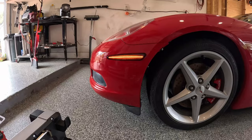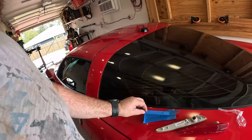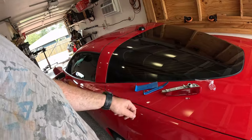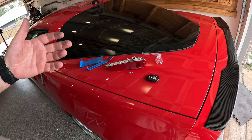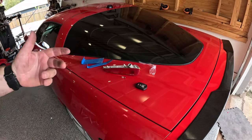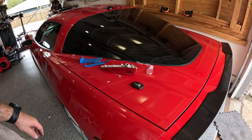There's the front and back. The more I look at it the more it grows on me. One tip: use two plastic shims — wedge one in and use the other to work around the panel. In Texas the heat deteriorates plastic, so I'm not expecting too much from them. These are side to side, so make sure you grab the right one. Hit the unlock button to test the light because the LED has a polarity — make sure it's not in backwards, and clip it all the way in so it stays snug.